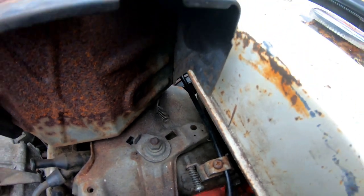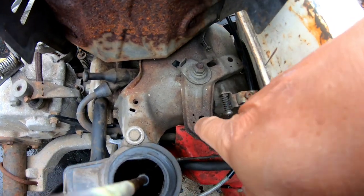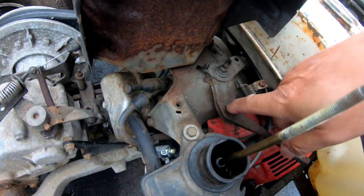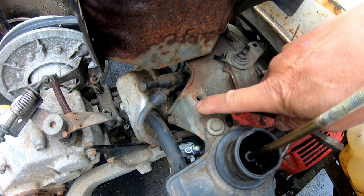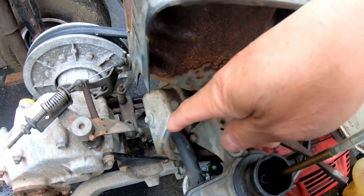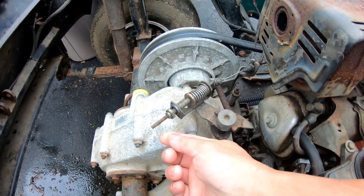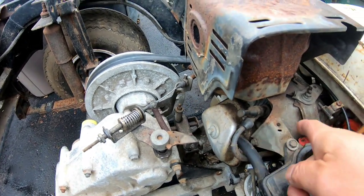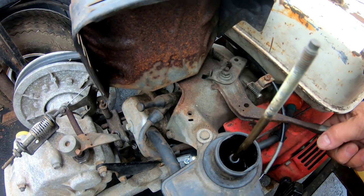Ideally, this thing should move very easily. And as you can see, this lever actually has a few holes there, which I could just add some type of connection here with a wire cable that's Z-bended into these holes that leads to a connection over here. So when I step on the gas, this pulls upward, cable pulls, and this thing moves this way.